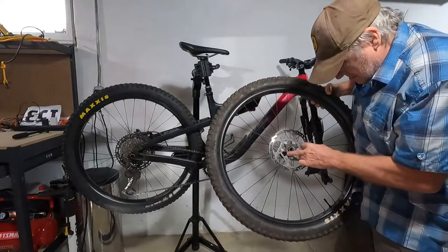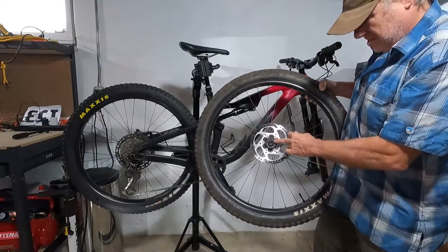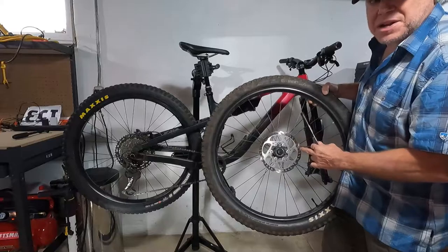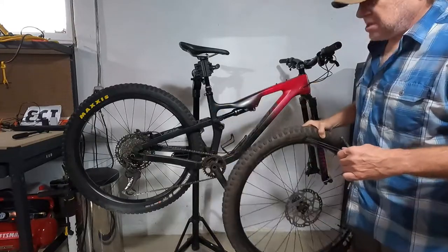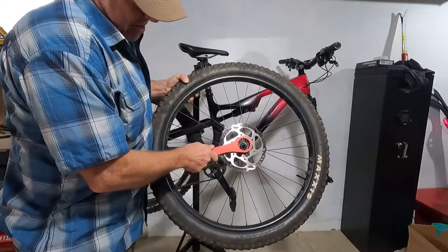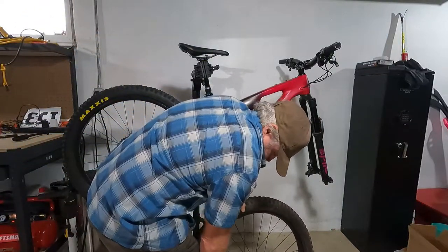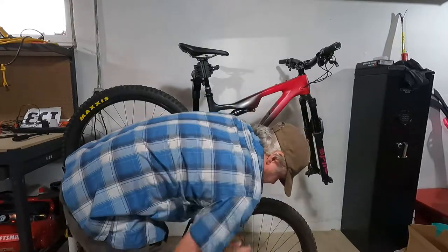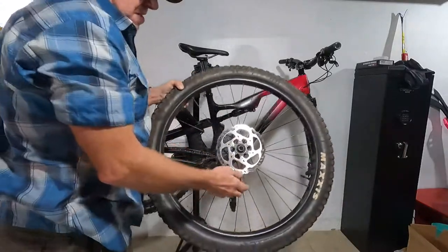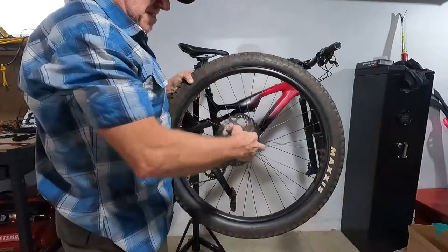Looking at this, there's a lock ring on the outside that looks like it'll just come off with a tool. I'm curious whether an existing tool I have will already do that — I'm going to guess maybe a bottom bracket removal tool, it looks pretty close to the same size. And just like I thought, my Wheels Manufacturing bottom bracket tool fits right on there. I just grab those teeth and it comes off. Now the disc will just come right up — that's actually a lot easier than dealing with the six bolts of a typical disc setup.